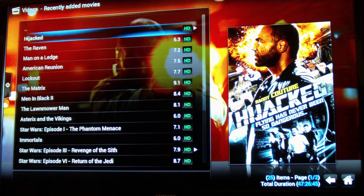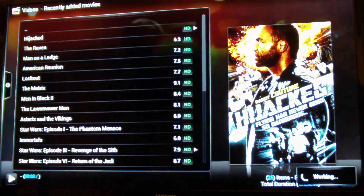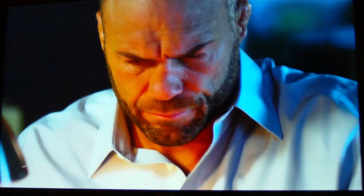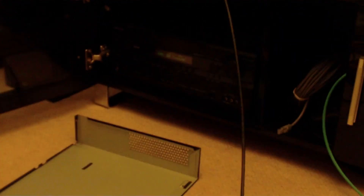I'll show you a bit of a movie playing in XBMC. This is built on Ubuntu 12.04 — as I mentioned earlier, I've had to update the kernel and NVIDIA graphics drivers. You can see Dolby True HD there, so I'll play it. The picture looks absolutely fine. Absolutely crystal clear. And if we look down at the amplifier, you can see True HD — True HD output in Linux in XBMC.